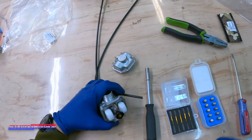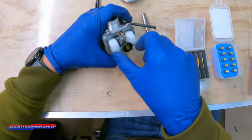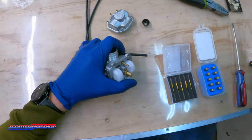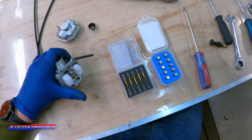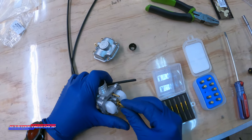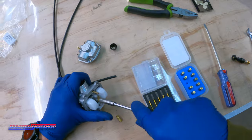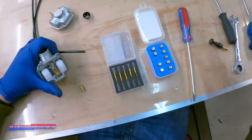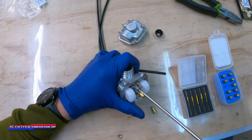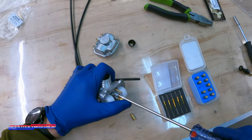However, some areas like Tennessee and Alabama need a ton of fuel and we're nowhere near sea level, so there are some areas that just throw things out of whack. You've got a little plastic cap here — this just kind of keeps fuel in the area around the main jet. Pop that guy off, take this main jet, pull it out. So you've got a 100 in here — you can start with a 100, it's going to be a little bit big though. Pull the 100 out and take your 94 and put it in this carburetor. Hand thread the 94 in — I use a little bit driver, works really well for doing jets. Snug that guy up, don't go crazy. Sometimes this little emulsion tube will come out — if it does, no big deal, just thread it back in. Stick with your stock pilot; if you need to fine tune your cruising and idle, you just unthread this pilot and go up or down in size. Very simple — but I would just leave it in there right now and start with your main jet.